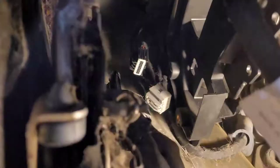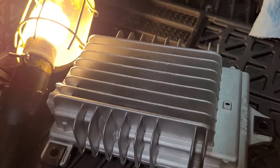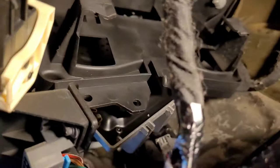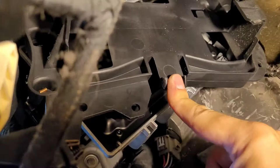That wasn't easy to get out of there. It's held in with three 7mm screws and it's really tight up there between it and the emergency brake. Then pulling it down you still have to get it unplugged by feel. These plugs are hanging down right here — just squeeze them. I've got a brand new amp; it was $318. I'm gonna put it in there and see what happens. That amp really wasn't fun at all, but you do need to get the body control module down to get the harness out of your way.